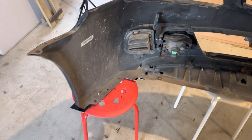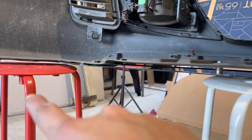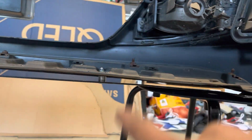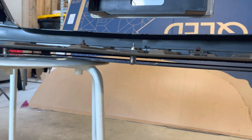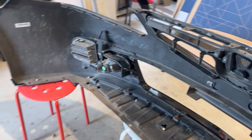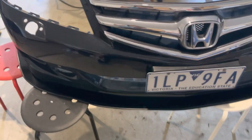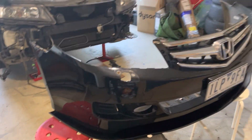All the mounting points are done now. You can see the spacers are just sitting underneath to clear that bumper mouth. Some cars will need bigger spacing, some cars will need less, but I'll always include what you need. All that's left to do is throw the bumper back on, and put on that grille first before I forget.